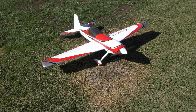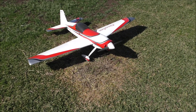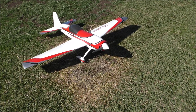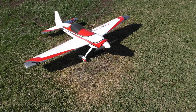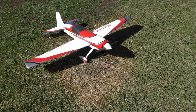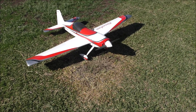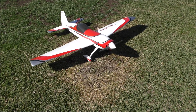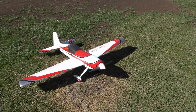So this is where we are. It's got a 50-55 motor in it swinging a 15x3 prop. They recommend you put a 42 size motor in it with an 11 inch prop, and they also recommend running it on 6 cell. I'm going to try it on a 4 cell just because I've got a bigger motor. So we'll see how we go — let's shut up and go.